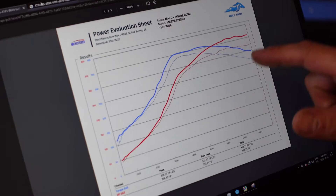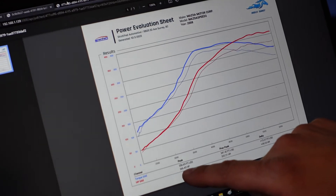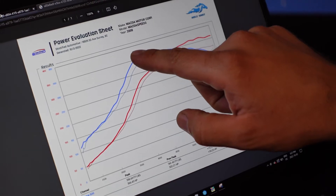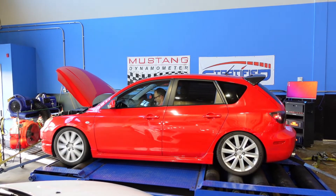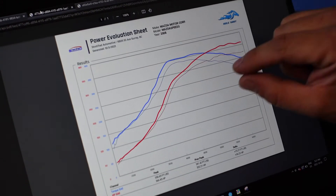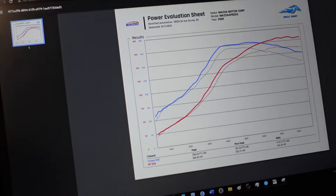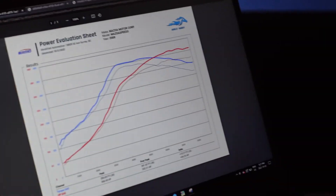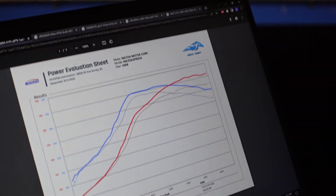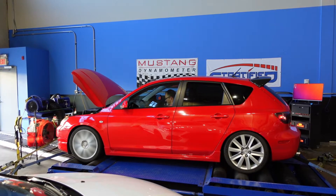It gets even better when you look at the E30 tune. We were at about 332 horsepower and now we're at 367 — so 35 horsepower extra. You can see the car spools up faster and carries power further into the upper rev range. Also note that the gap between the two curves increases up top, which is a clear indication that flow through the entire engine has improved. You always pick up top end when you increase flow — a really good update to the car.